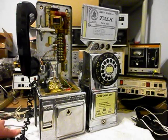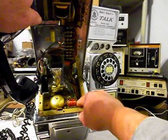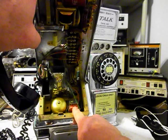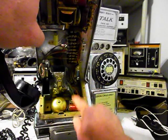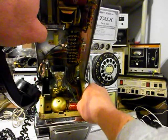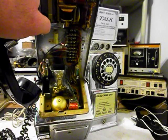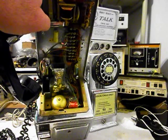We also, in the note, he mentions that the bell does not ring, and this is the bell that's installed in this telephone — it's kind of flopping around in here. We do not use this type of bell in our conversions. This was one of the Western Electric bells, about the only thing that Western Electric ever made that wasn't very good design. They don't ring very well just due to the way they were designed. We checked it earlier and it does get voltage and it does try to ring, but it's just a poor design. So we'll be installing a different style bell.